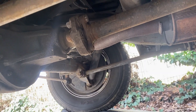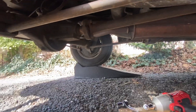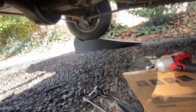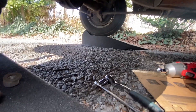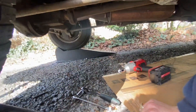There it is — there's the old one. I had the first three bolts off. I have my impact which is useless in this situation, but the torque spec is only about 72 Newton meters so I didn't really need it. It's also tough to get in at an angle. You do need a 19mm socket — actually two 19mm sockets — to get it off. I don't know exactly what I'm doing, but the plan is remove all the bolts, pull the drive shaft away, and replace it.